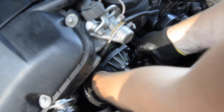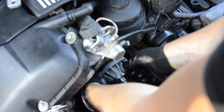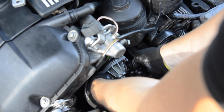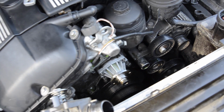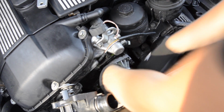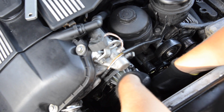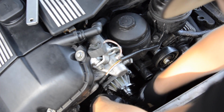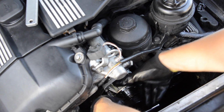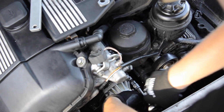So I'm doing it with my hand right now. Just one and another one. The bolts from the thermostat fit perfect, so you don't need to use any other bolts and wonder what kind of thread it is. So thermostat bolts work here perfect. And now I'm just gonna tighten them a little bit. One side, other side. That's how it goes. And you see it's moving nice and good without any force, because if you force it in this direction, you can slip and damage the radiator. Easy, like this.